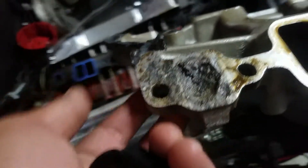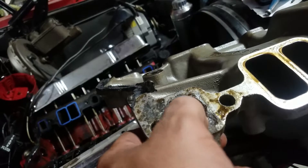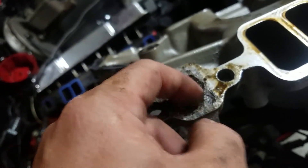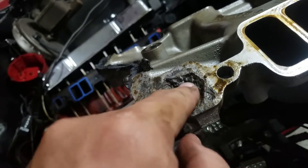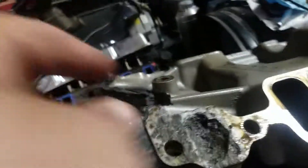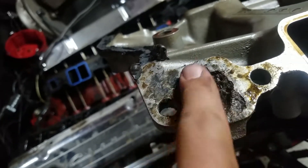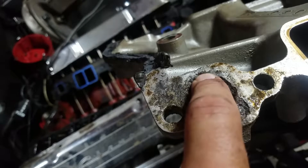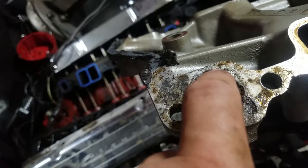You can see just the amount of corrosion right here. Now this intake manifold is pretty high quality — the deck on this is probably close to half an inch, so we've got a good amount of meat there before we get pinholes on the other side. What I'm going to do is get really aggressive with a steel bristled brush, chip all this out, drill these out, get some shiny aluminum, and then instead of using JB Weld like this guy did — good effort, good thinking, but not enough — I'm going to use RTV. I've never had that stuff come loose and we don't necessarily need a flat surface since we're not sealing anything critical.